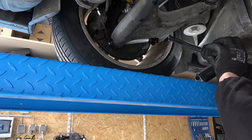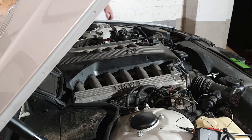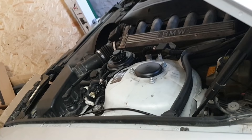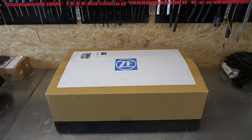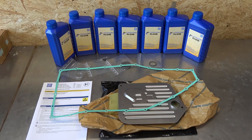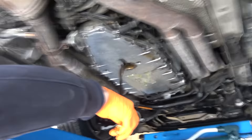Next task: there was an awful screeching noise from the transmission every time you start the car cold. Upon a second try the noise was not present, so it was time to service this transmission. I bought a ZF service kit that comes with everything needed for this job, including printed instructions. First I'm removing the fill plug — oh my god, that's disgusting.